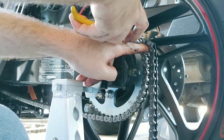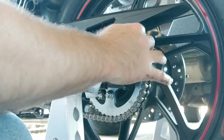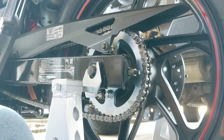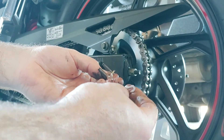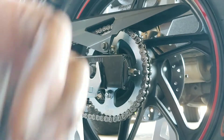It's in the way, so just the same way I got the old one off, I'm going to get it off again. I'm going to pop that little key out — it's always a little harder the second time because I don't have the right angle. Came right off — it's always a good sign when it goes that easily. I'll take that old chain and put it in the box. Because it has 50 miles on it, let's say something happens — I run into an issue with this new chain. That old chain can be a spare I can throw on the bike until I get another one. My new chain will have the same key, same pieces, same link type and everything.